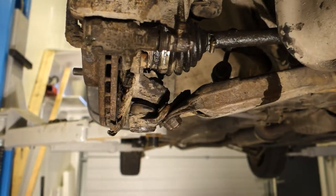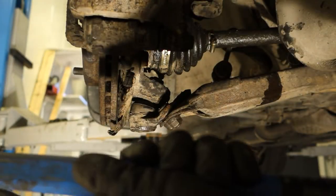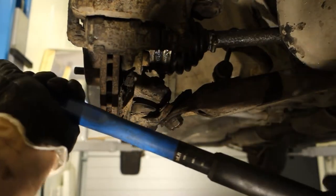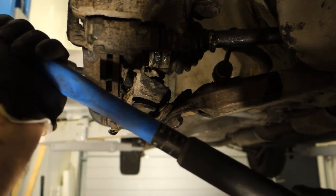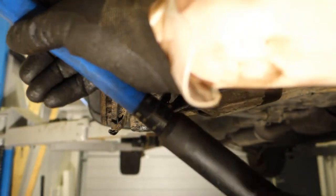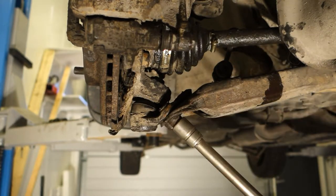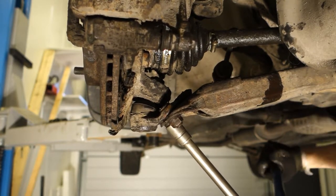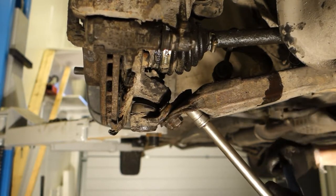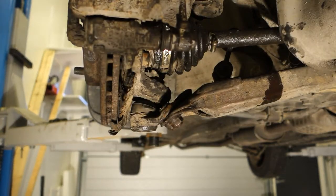Okay, and then these ball joint bolts in here, and the torque wrench amount is 100 newton meters of force. 100. I rotate in here 100. They must be tight. Okay, now there is 100 on the scale, and then I fasten these bolts, and when we hear this click, the force is enough. Okay, good. They are fine. And then the tie rod end also.